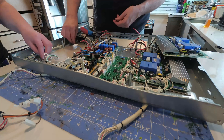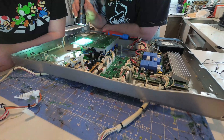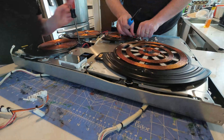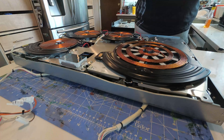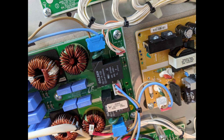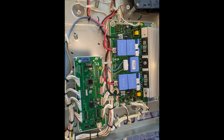I have some guarded confidence that the repair will hold, but the solder also kind of looked like it wasn't wetting the relay contact as I expected. So maybe something's going on with plating on that component's contacts. The first failure took four and a half years. I'll update the comments on this video if I gather more information over time. If you aren't confident in your soldering abilities, board level replacement parts are available from appliance parts suppliers. Have your serial number handy because there are significant design changes using the same model number but different revisions — I have Rev01, which I found after a lengthy convection fan replacement ordeal.